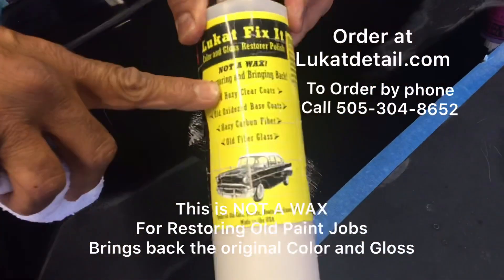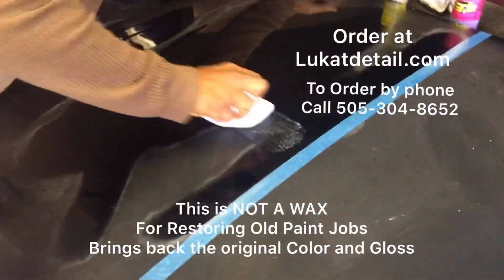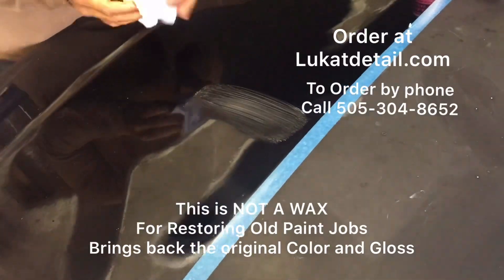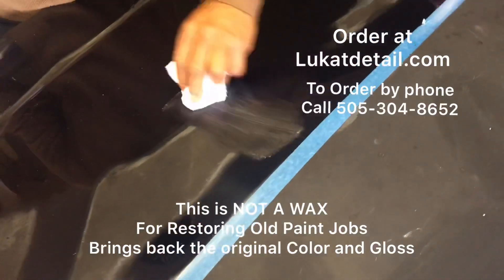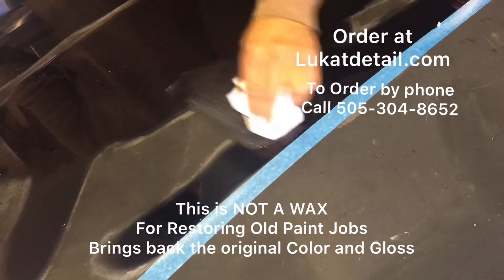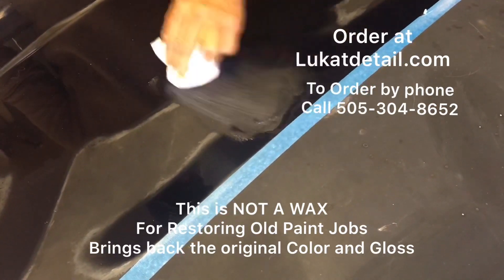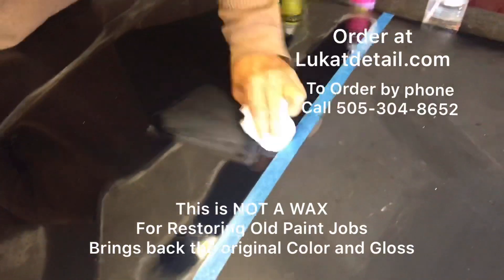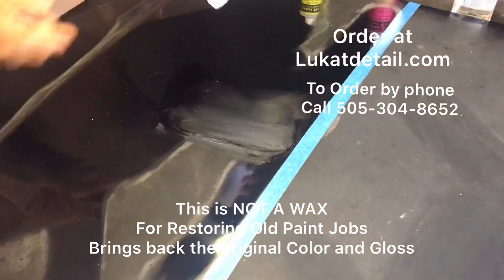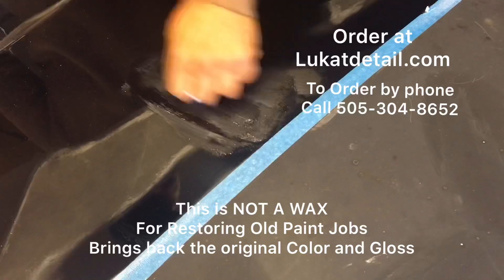This is not a wax - this is a dedicated paint cleaner. This clear coat doesn't need more wax; it needs to be cleaned before we wax it. When you use this, it's very simple: you just polish the same area until it clears up, going back and forth. What happens is it permeates into the striations of that crusty layer, breaks it up and removes it, but it doesn't bite the good paint. It's not a wax or a cutter - it's a cleaner. You're able to clean the paint job 100% back to its original state.